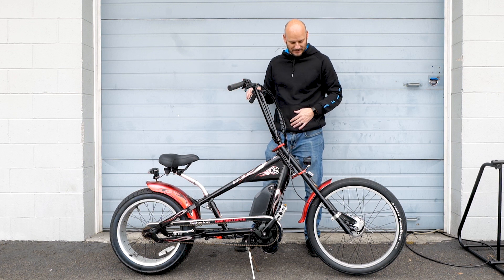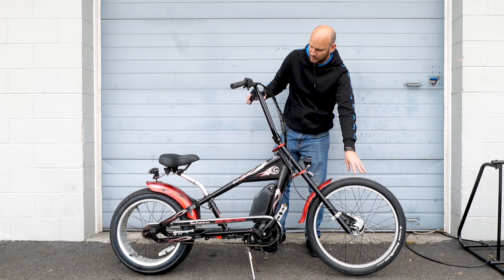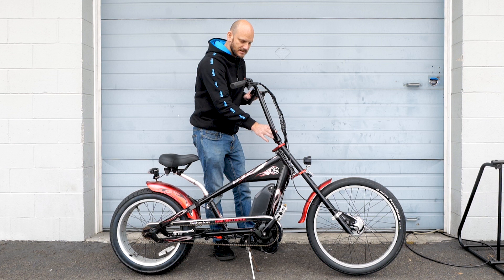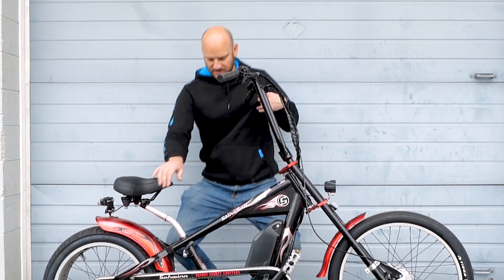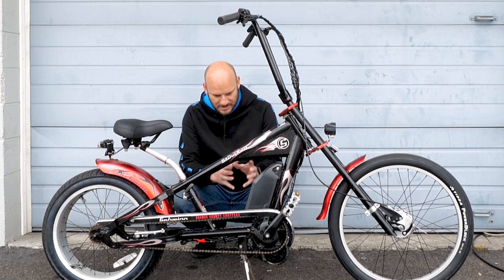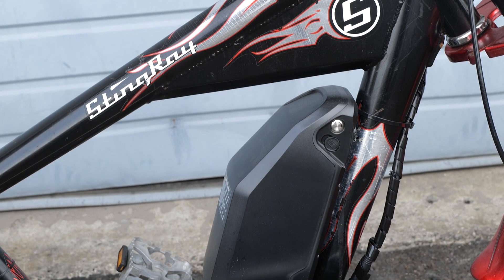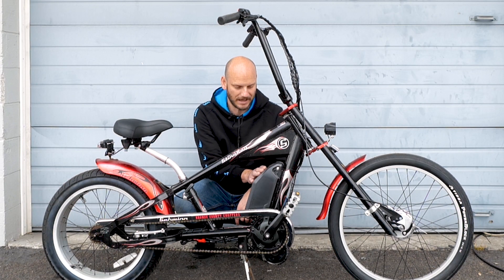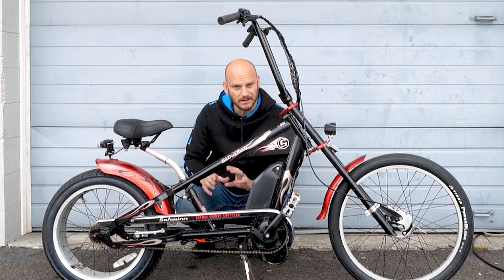Well under a hundred bucks. So we upgraded the front rim, put new tires on front and rear. We went with the 500C color display — we originally wanted to go with the P850C, but it wouldn't fit right here with the stem. Obviously this triangle down here is pretty unusual, so we couldn't put a big battery in here unless you went with an odd-shaped one. So we went with the wedge battery, which is great for fitting into tight spots. If he wants more range, we'll probably just add a second one.